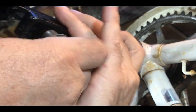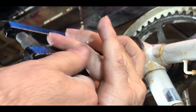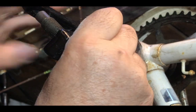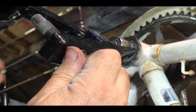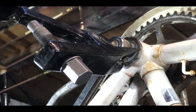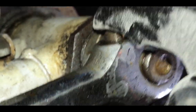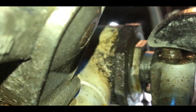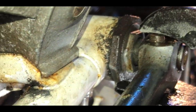There are tools specifically made for this job - it used to be available from Park but not anymore, and Bike Smith in America make very good tools. They use the pin part to bear down on the cotter, so there's less faff - it's just like a big U-shape with the pin going through, almost like a big G-clamp. Less faff in the adjustment - I would like one of those, but they're expensive and hard to get. Now I'm showing you where the tool is on the end of the cotter - you can see how it's clear of everything. When that jaw was longer and came down more, it just wouldn't give the full amount of push on the pin. That should push it much further now.